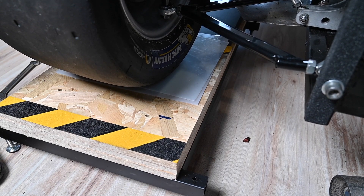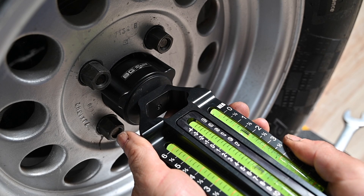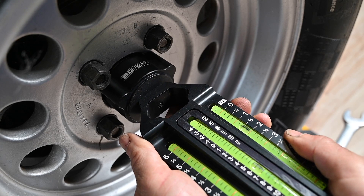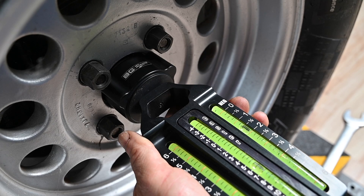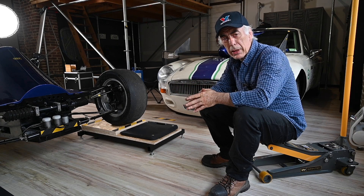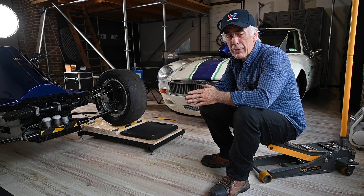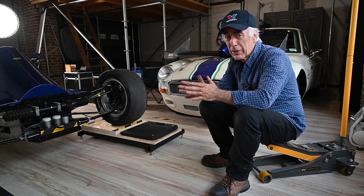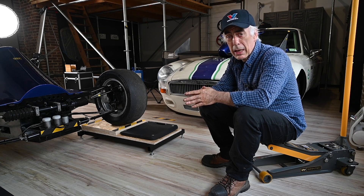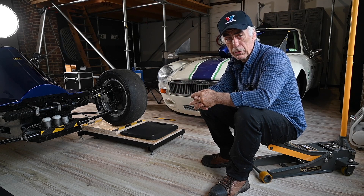Now I want to have the suspension settled, so let's check again. Now we have about 1.75 degrees of negative camber — I'm happy with that. So folks, we have come to the end of this video. We've been setting the camber in the back of the car to about 1.75 degrees negative camber. In the front I'm going to set it most likely to about 0.5 degrees negative, maybe 0.5 positive, but that may change depending on the track. It's not all that hard — all you need is a level floor, a couple of tools, and a lot of patience.